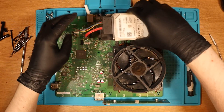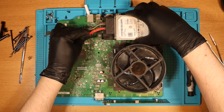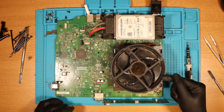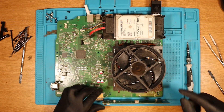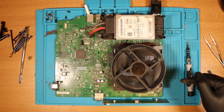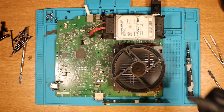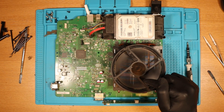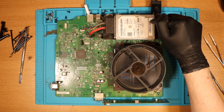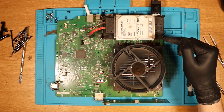I've just switched over the fans. I want to make sure that the noise is gone, so I'm just going to plug the hard drive in and then plug the power in. Make sure this is stable. Can we get a little notch? Here we go. Any noise? We have fan spin. Silent fan spin, I should add. Wicked. I'm going to give it a clean, put some new thermal paste on, and probably test this one terabyte hard drive in my PC just to make sure that it is 100% healthy.